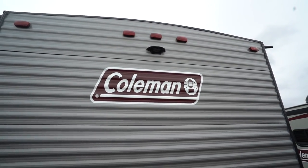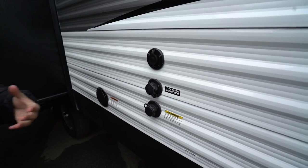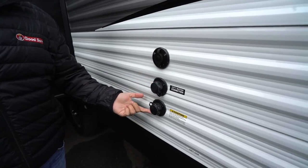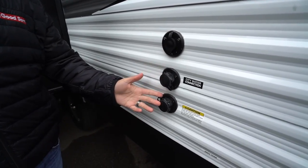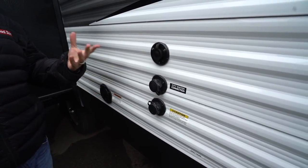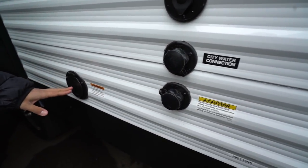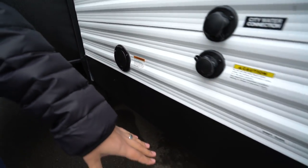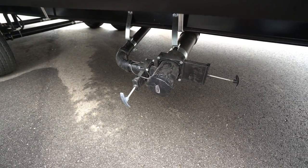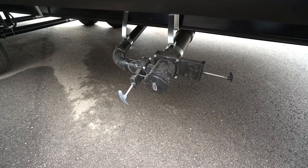Having the backup camera prep there, just like the Wi-Fi extender prep, just makes it a little easier to install and saves you some money. On the off-door side you'll see your cable inlet right up top, city water inlet underneath that, and then your black tank flush — this is great to have. It's nice and simple to use: just take a garden hose, hook it up here, and anything that didn't get washed out with your black tank, this will help get rid of that — there are sprayers built right into it. Your 30-amp power cord is housed right over here. Right down below is your main termination with both your black and gray tank valves. There is a secondary termination up near the front where you have a second gray tank.